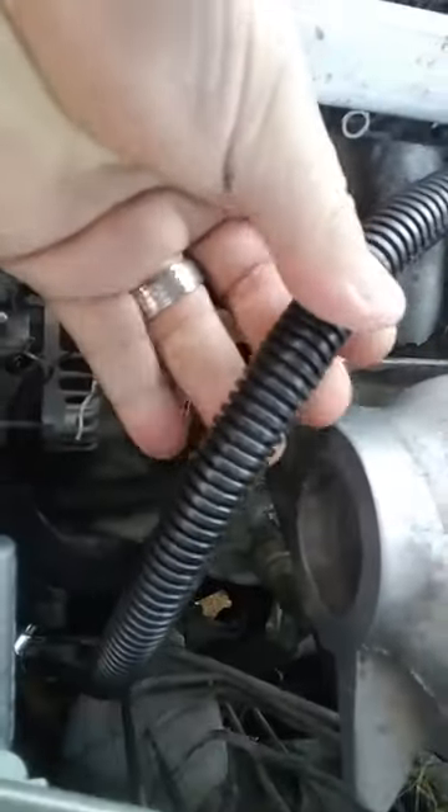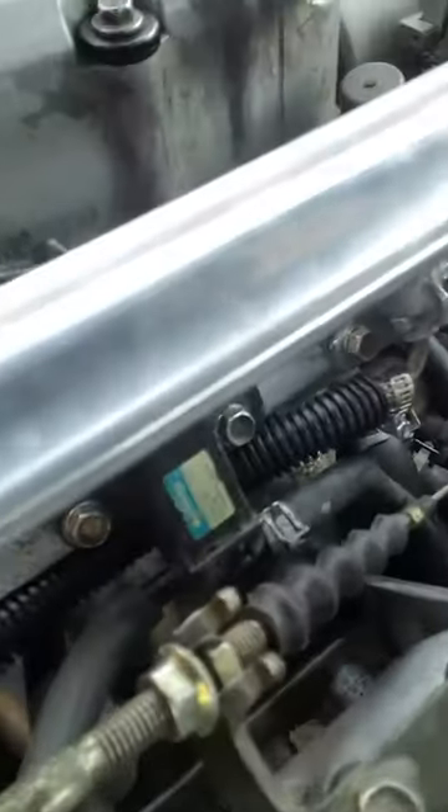The issue is that it wants to die when I'm at a stop sign or stoplight because my RPM went down to those one to two bars. I changed that out and it didn't help. Next thing I thought, my fuel pressure regulator hose was too big. I swapped that out — got a smaller hose, a 5/16 hose for fuel injection systems down at Nampa Auto Parts, braided as well with a wiring loom and two fasteners to tighten it down. It runs all the way to my fuel pressure regulator. That didn't help. I did a fuel filter as well. I did a fuel pump. It didn't help that situation.